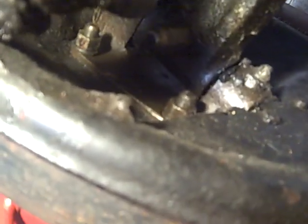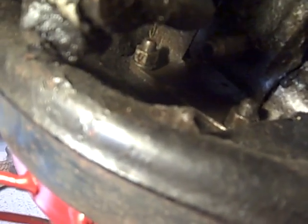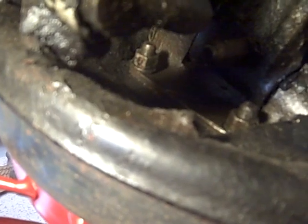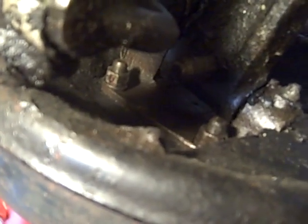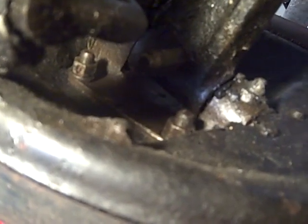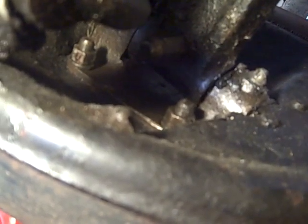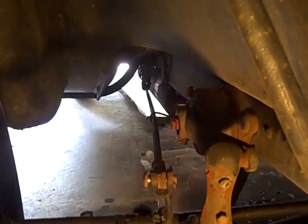It's running right through that axle shaft, and that rod is pushed down by a lever on top, and that pushes a wedge down that expands the brake shoes, and it's in there you would put the pill. You can get somebody to help you put the pill in. It's not that hard. It looks bad from here, but once you get the drum off, it's pretty straightforward.